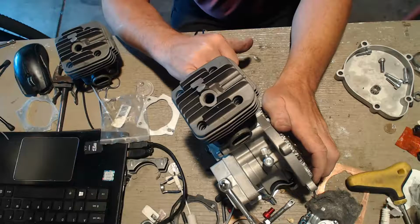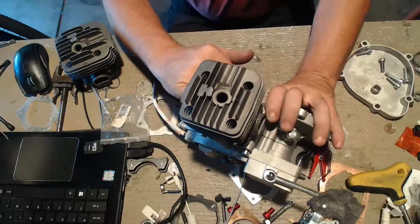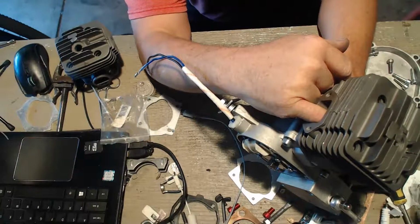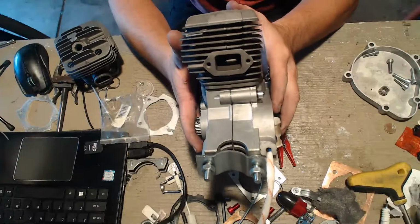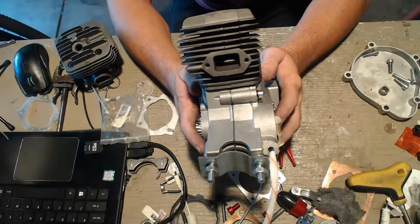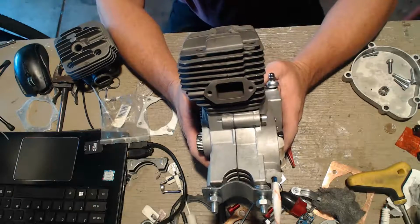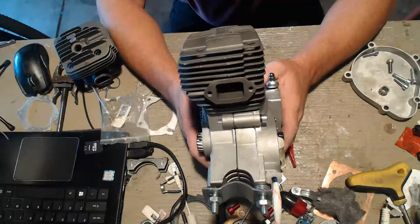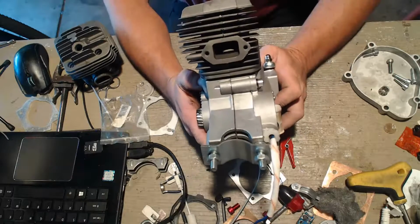And that's my crosstalk. My sweep is a 1/8 of an inch. What I'm doing is I'm sticking my finger in and feeling how far down the piston goes. The crosstalk would be seen through the other side. That's what I call crosstalk. That means that the exhaust is going to blow back through your intake and back through your carburetor, and it's going to be a little stream of fuel coming out. And that's called crosstalk. If you have any fuel going backwards in your carburetor, you have crosstalk. That's at 0, and that's my crosstalk I'll have to repair.